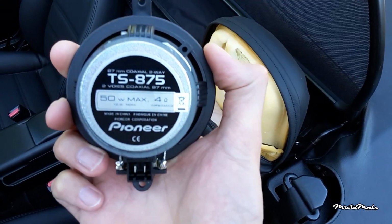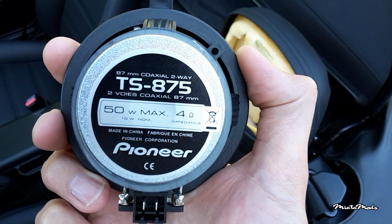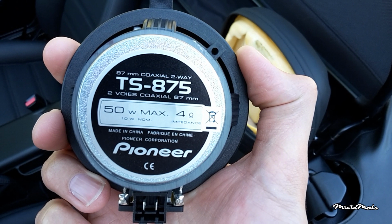So I got the Pioneer TS875. After doing some research I found out it would be better to use 8 ohm speakers instead of 4 ohm speakers, especially if you want to use the existing wire harness. Don't worry, I will explain this in my next video, and I will put a link of this video in the description. Now, back to mounting the speakers.